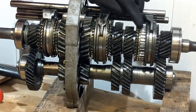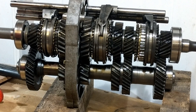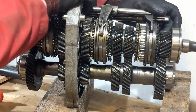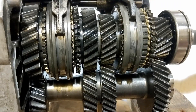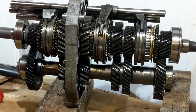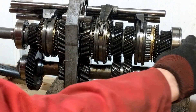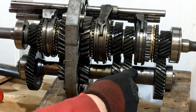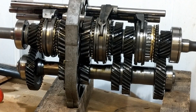I'll move into four for a second and you'll see the centre hub. You can clearly see the synchro ring here. If I now move into the desired gear — in this case third — the selector connects the centre hub with third gear. The power now travels from the clutch down into the centre shaft, into third gear and up into the main drive shaft.